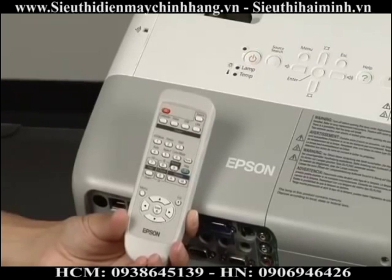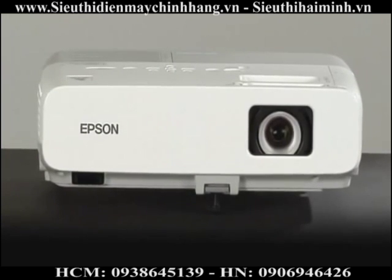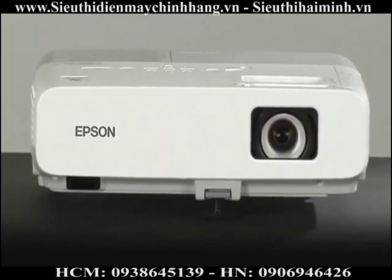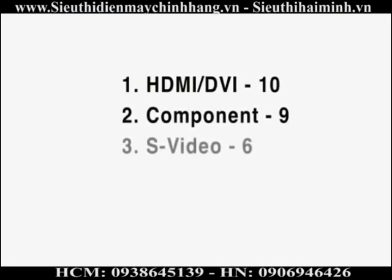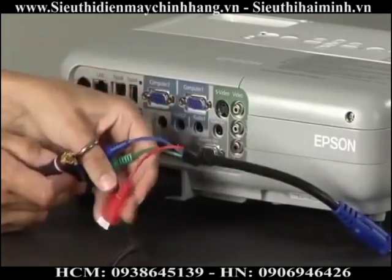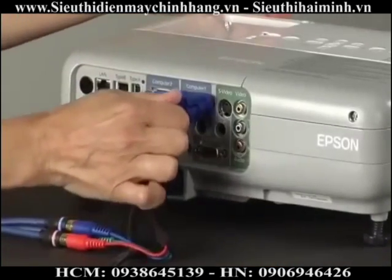A little note: if you are using your projector with a device other than a computer and video quality is important to you, here is a list of the video connection quality on a scale of 1 to 10, 1 being the worst and 10 being the best. HDMI and DVI are the best, with Component in a close second, followed by S-Video, then VGA, and Composite falling in last. To use Component, you simply use an adapter that converts VGA to Component and connect the VGA side to the projector's computer port and the Component side to your AV device.